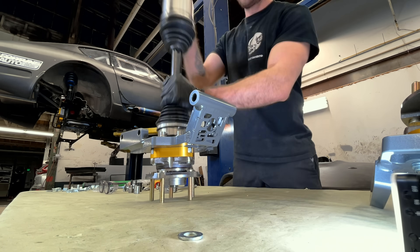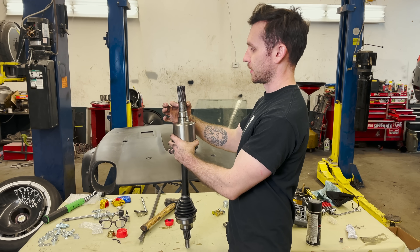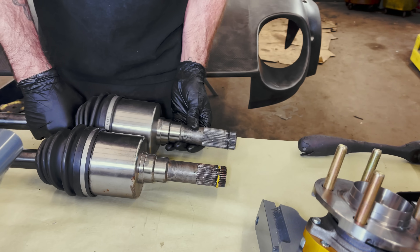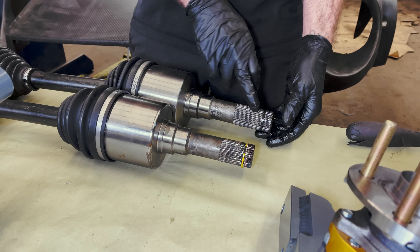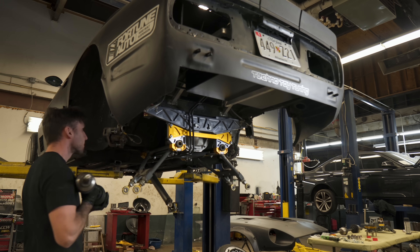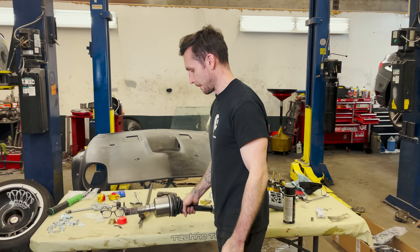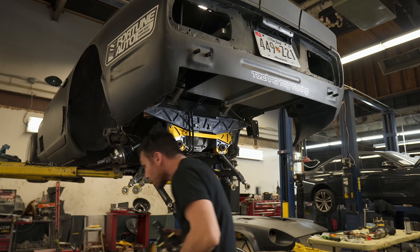So we realized after the fact that the axles are actually different sizes. This one's got a little conical shape where the other one's flat, and this one's actually slightly thicker. They have two different color rings — black and yellow — which we should have realized. The yellow ring should go on the passenger side because it has a slightly thinner collar, and the black ring should go on the driver's side. We put the yellow on the driver's side, but we accidentally popped it all the way in to the clips and I don't have the axle puller tool here at the shop. So we're going to do that another day.